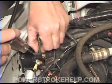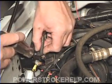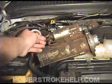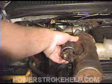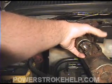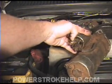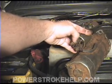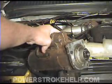This wire here is what comes from your ignition key, and this wire here is what goes to the starter — it's actually attached to the starter right here, going underneath the truck. This is where it's attached to the starter, on the back of the starter solenoid. There are actually two starter solenoids on the Power Stroke Diesel trucks. There's a large hot cable that comes straight from the battery to this terminal, and when power comes here, the electricity is transferred and engages the starter, with the gear that engages the flywheel and starts the truck.